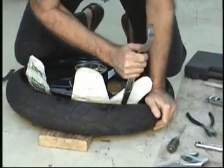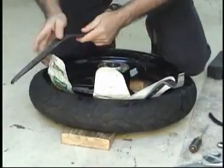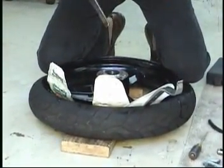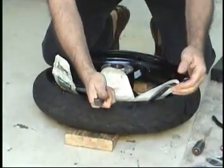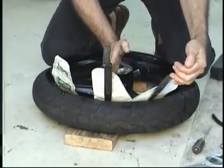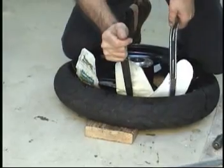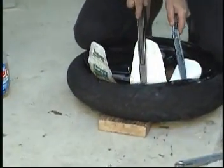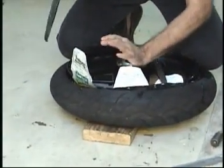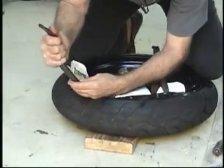Now, never let go of the tire lever. I can't now, but when you have tension on it, never let go of this guy. They always stay in your hand because they do fly out. This thing is like a spring. Now you see this? This is 11 o'clock. This is 12 o'clock. This will be 12. This is 11. Right? So you want to work in 1 o'clock positions. And that wasn't so hard, was it? Pull this guy out. You notice I never let go of this guy, or at least I'm guarding it. So if it does pop up, it's not going to take out my friends on the other end.